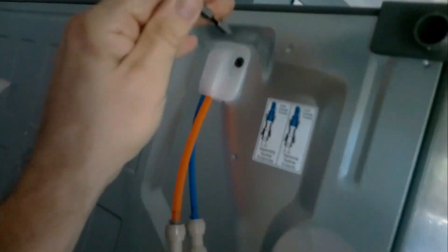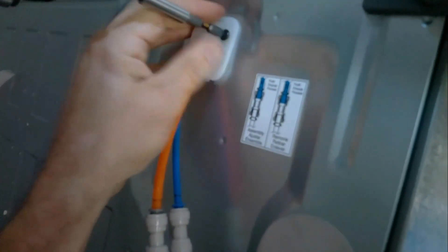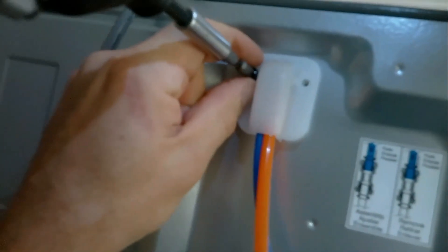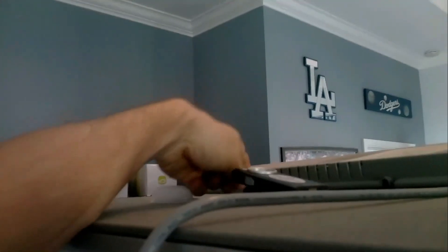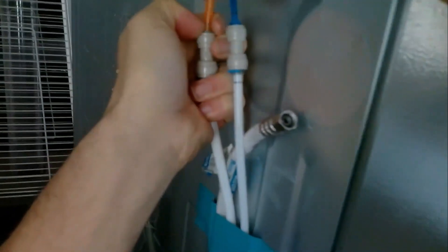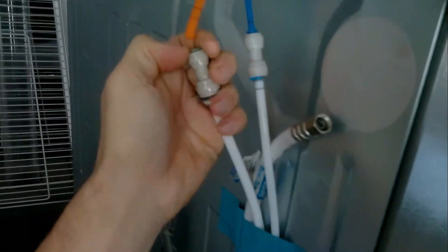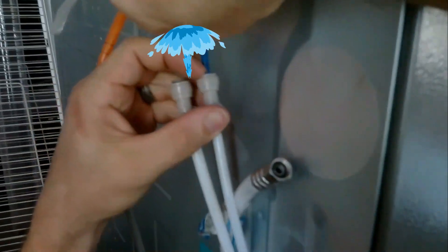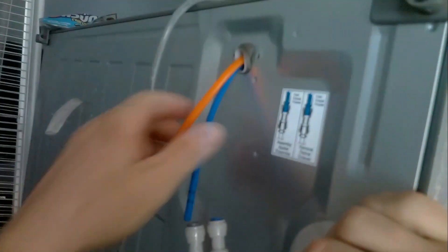These are the two hoses that you will have to remove to pull the hoses through the housing of the fridge. There's just two Phillips screws — put them somewhere safe where you won't lose them or get confused. Once you remove this, then we'll disconnect the hoses. They have little connectors — hook-up connectors. So you press them down and press in and out of the hose to release it. You may have some water, so have a towel or two ready. Press down, push in and out.